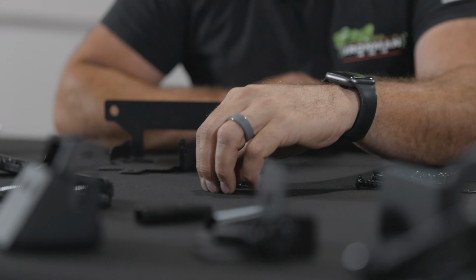Oh, cool, that is off. All right, now we gotta pull the headlights out. So I'm gonna start with the driver's side, grab a 10 mil, and we're gonna pull this bolt right out. When we're done with that, we're gonna take the clip removal tool and pull that little plug out. So there's the 10. Set that down. Sweet. That is out. Now we'll swap out to an 8 mil. And this guy right here.